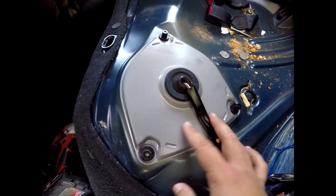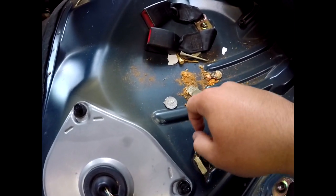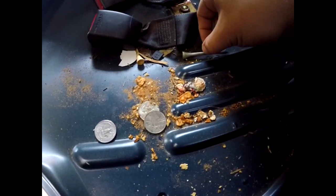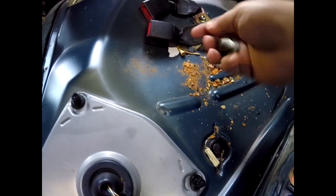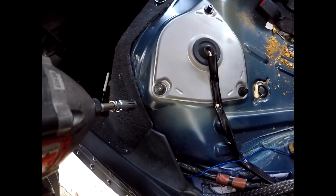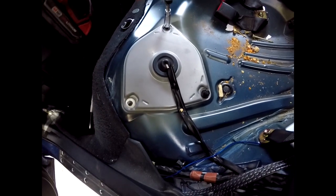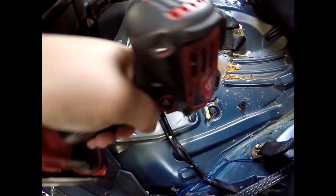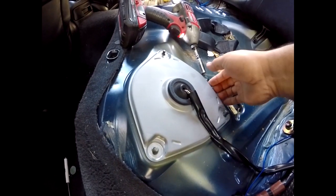So this is where the fuel tank is right here - this is the connector for the fuel pump. Naturally he's got 75 cents and a golf tee and a whole bunch of snacks down here. We're just going to take the 75 cents - there's even some pencil lead in here too, which is weird. Anyways, these are 10 millimeter bolts right here and we're just going to use our impact wrench to get those off.